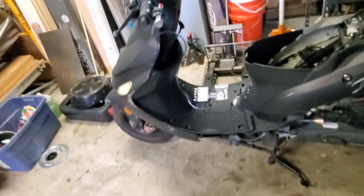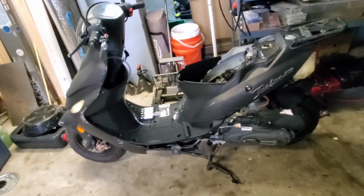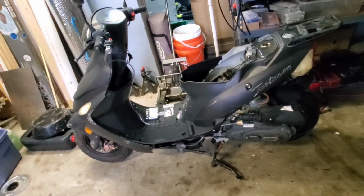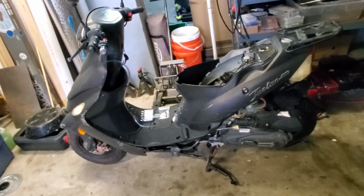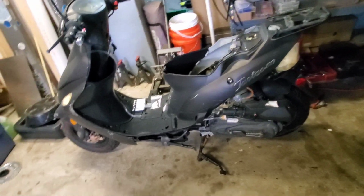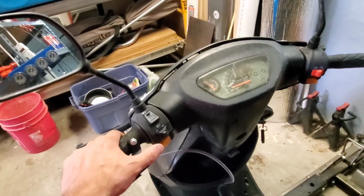We'll talk about how to use nitrous properly in the next video, because I don't want you guys to think that once you're going as fast as a scooter possibly can, that's when you hit the nitrous. The reality is that's how you blow up your engine. NOS is meant to be used kind of in the power band area. So when you first take off, it's really hard on the engine to spray. So I wouldn't spray when you first take off.